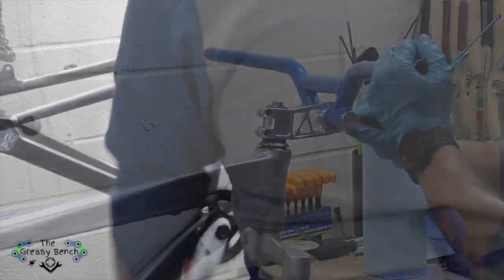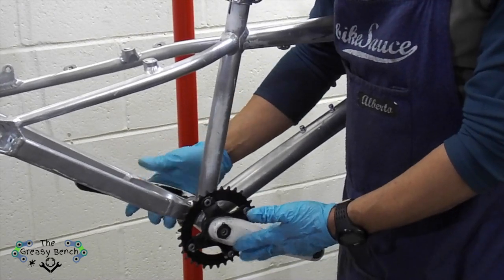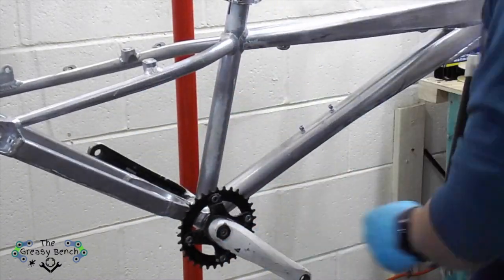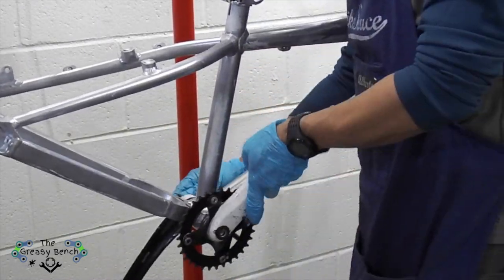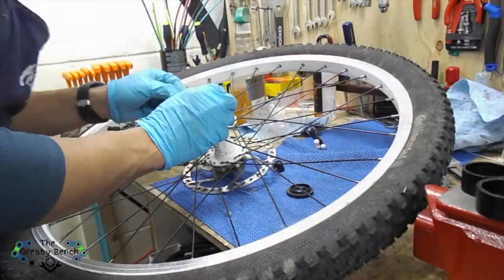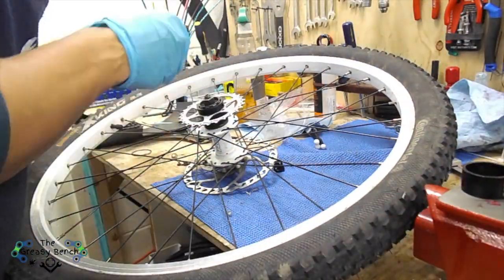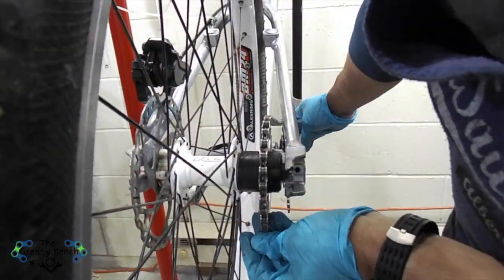Now I'm putting on the cranks, because I want a good way to measure the chain. You can put the cranks in funny positions just to have fun, but tighten the crank bolts to 40 Newton meters. After that, I prep the wheels — remove the cassette and install the single sprocket with the spacers. I've already tested the measurements and now I'm measuring the chain on the frame.